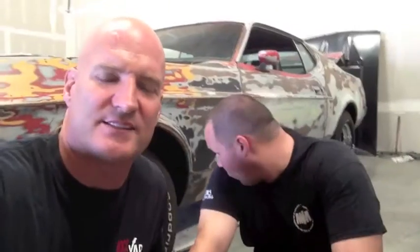You can put a little bead of silicone if you'd like, just to seal it. We're gonna do a little bit of cleaning back here. We've got 65 and 5/8 on both sides — 65 and 5/8. I'm going to tighten up the tie rods and take her out for a little spin.